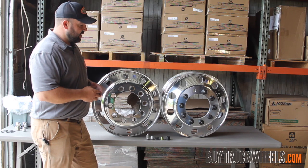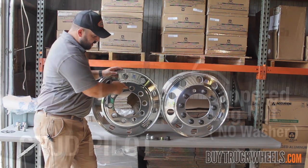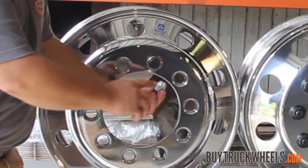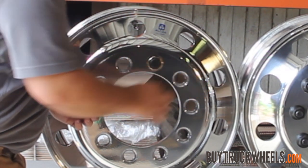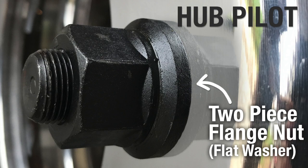The way we're going to determine which system you have is by looking at the lug nut. On the stud pilot or ball and seat system, there is no washer exposed. The lug nut — I'll show you kind of a mini version — is going to be tapered or like a ball, and that would actually seat, ball and seat, down into the bolt hole. Whereas on our hub piloted setup, we have a washer, and that is just going to butt up firmly against our flat bolt mounting surface.